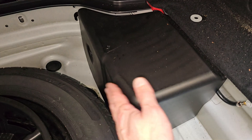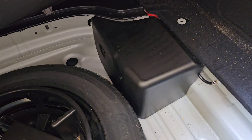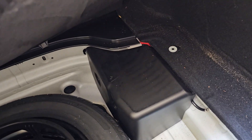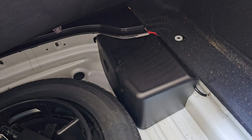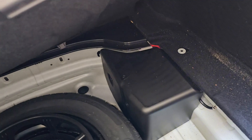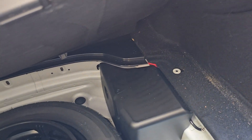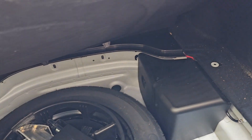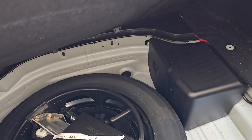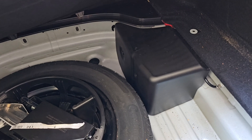Under this black cover, it is responsible for holding memory and it is a support for the main battery. So if your start-stop was working — you stopped at traffic lights — the power will be coming from this to sustain the radio and all of the functions in the car. If you're changing the main battery and disconnected everything, all the memory — the radio history, service history, everything — is going to be sustained through this battery.